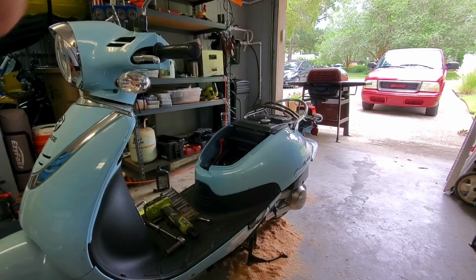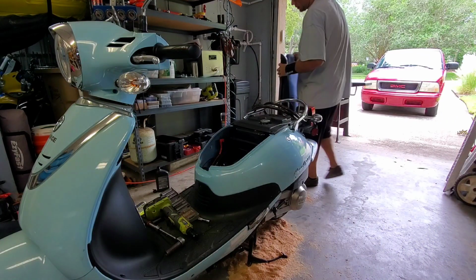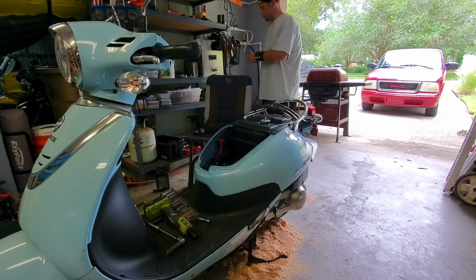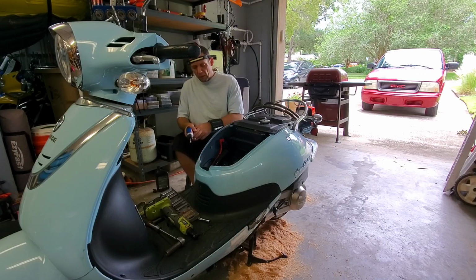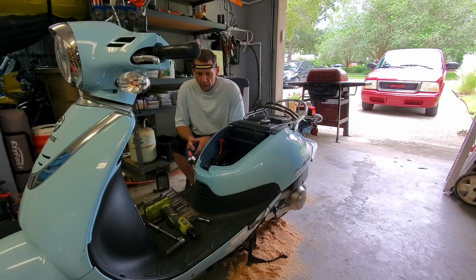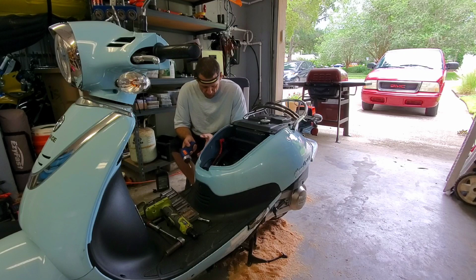Well, what's up, guys? Back to day two here. I spoke with Cecil, who's the customer. And I told Cecil that it could be one of two things. Either there's been some pretty catastrophic engine damage caused here, which would honestly really suck if that was the case. But there's two things that this could be. There's either ring damage, I say that because of the amount of metal shavings that came out of the oil, or there's valve damage.